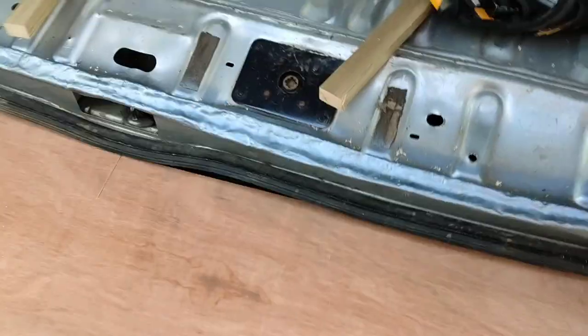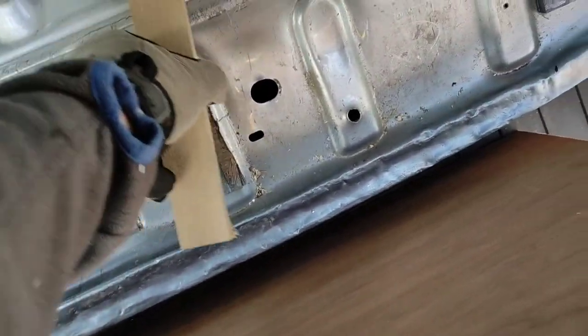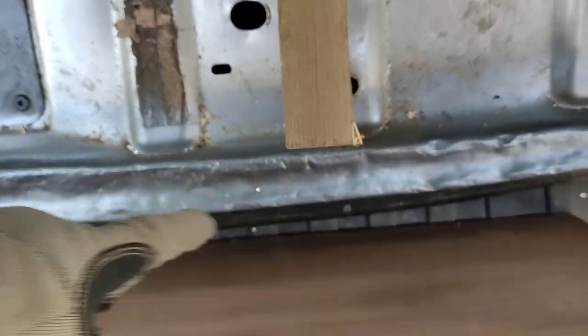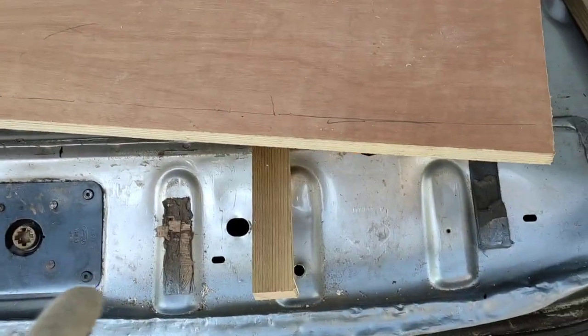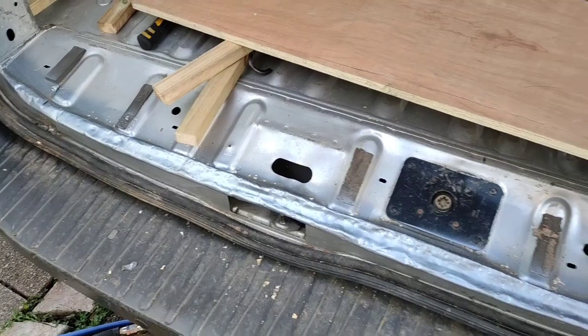To try and solve the issue with this back end being caved in, I'm going to make up a backing plate which will sit across the back and come up to the bottom of the floor. It's going to screw into the end of my garage support, so they come to here and the plywood sits in there. I've used my scribe to mark this section along here — now I'm going to cut it out with a jigsaw, and then once I've got that right I can measure it flush with the top of the floor level and cut a dead straight line, which should give us nice support and a clean finish on this back edge.